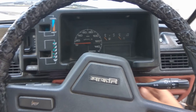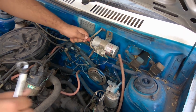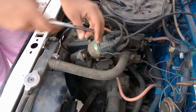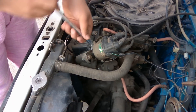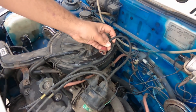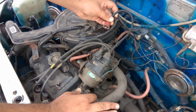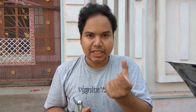With your flywheel marking in place, turn and keep the ignition on. Now remove the plug that leads to the distributor. With the plug removed, loosen the distributor cap using a size 12 wrench so that it can rotate. Then hold it close to your air filter and start moving the distributor in either direction until you hear the sound of a spark. Once you hear the spark, stop there. That is the position where you tighten the bolt back.